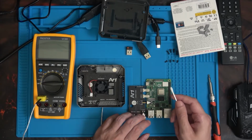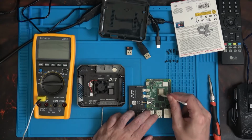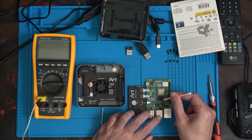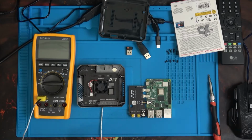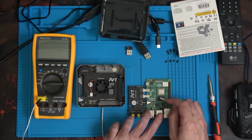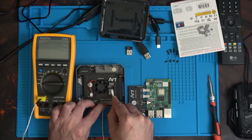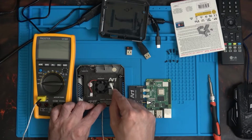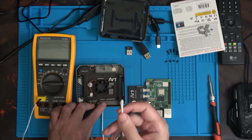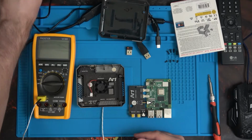Okay, so the Q-tip is completely soaked in the electronics cleaner. Go over this chip, the CPU. There's more left behind on the GPU. Don't want any of it left behind. That's nice and clean. And just to be sure, the contacts of what's actually on there. Okay. You can see maybe that there was still some on there, even though it looked like it was all nice and clean. So put that to the side and let's take out this.